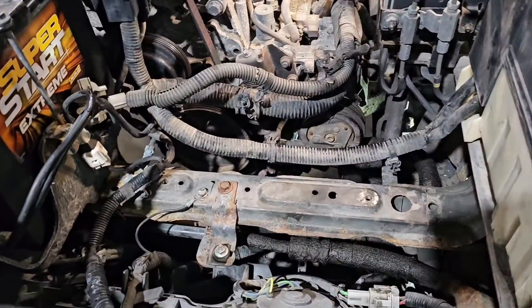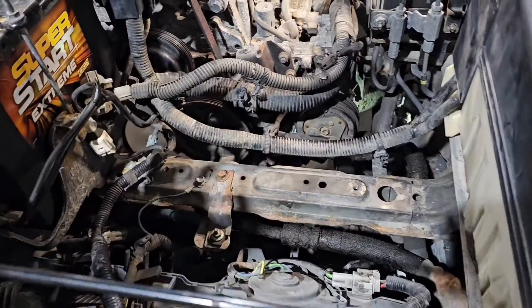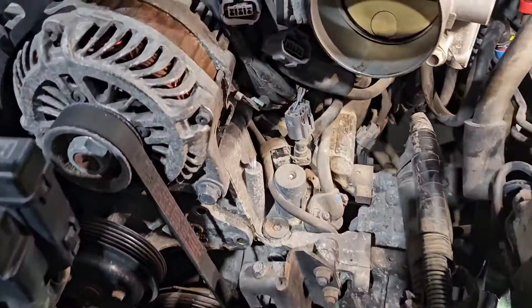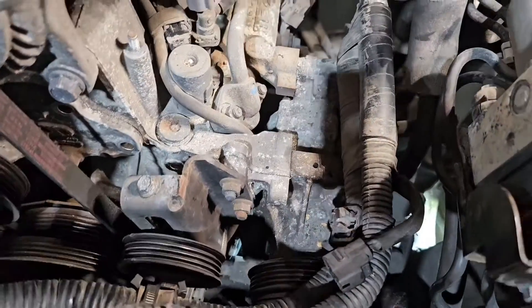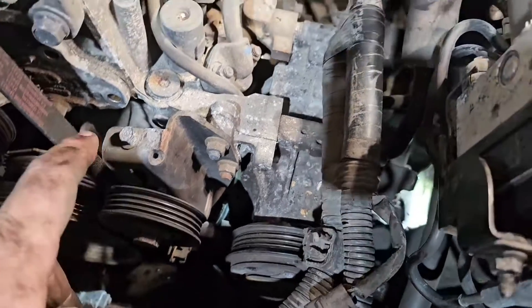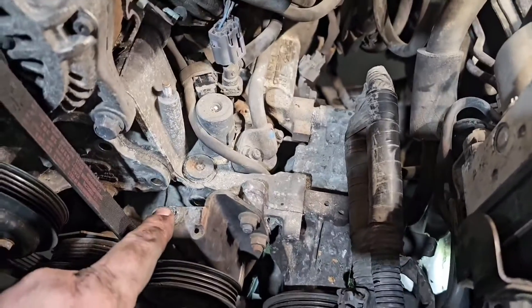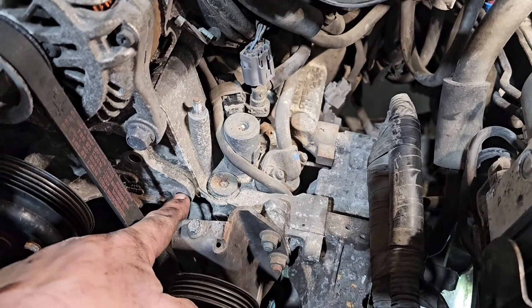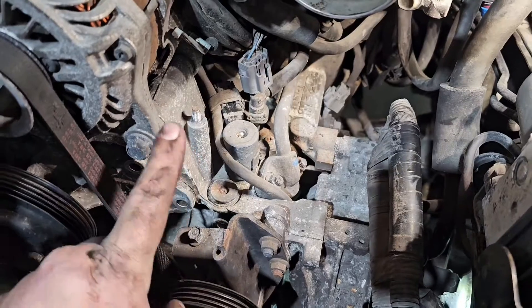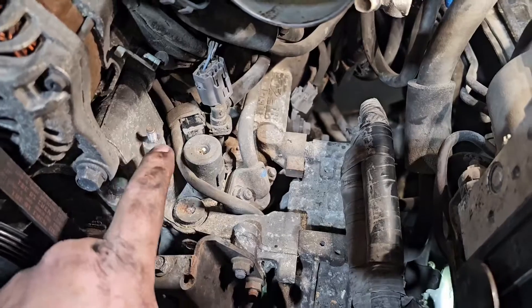To make your life a little easier, it's probably easier to just get the whole air box assembly out. I took the belt off for the AC compressor — it's just a 17mm bolt there, then loosen a 10mm and this pulley drops down real easy. Then I took these two 12mm bolts out that have the engine hook on it.